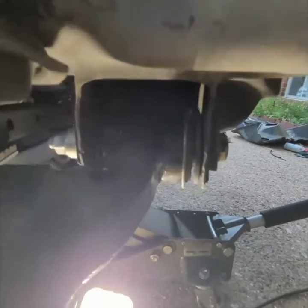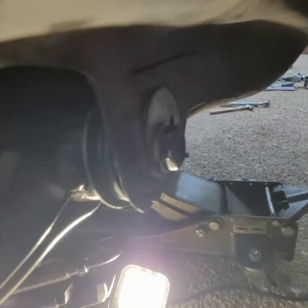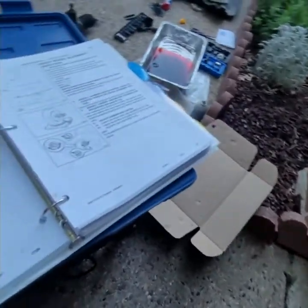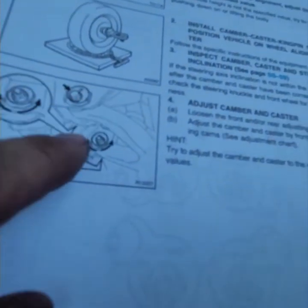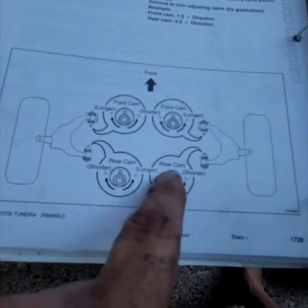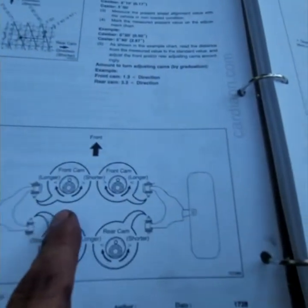We're seriously out of sunlight — last things. The adjustments here use 22 millimeter and 19 millimeter — same on the other side, 19 and 22. These adjust camber and caster — we're going to let the pros do that part with the alignment machine. The four bolts on the control arm — rear cam, front cam — you torque the front and rear adjustment cam set bolts to 96 foot-pounds.